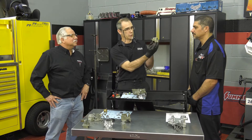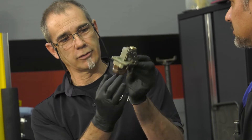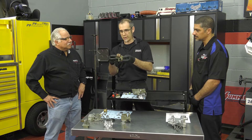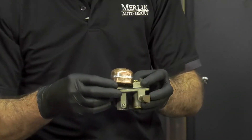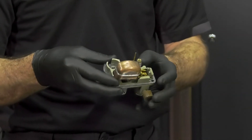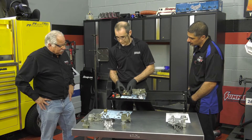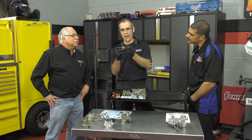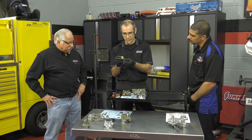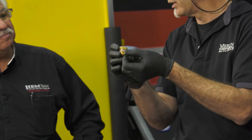The fuel pump pushes fuel in, fills it up, shuts off, lets the fuel flow, then shuts off again. This particular one has to be set to a half an inch — we've already gone ahead and set this one. It's very important that you set that correctly. Too high is wrong; too low is also wrong. You set it mechanically by literally bending a tab. There's a tab right here that sits on top of the needle and seat. If it's too high, you bend it down. If it's too low, you bend it up.